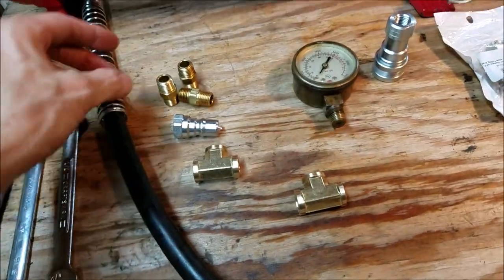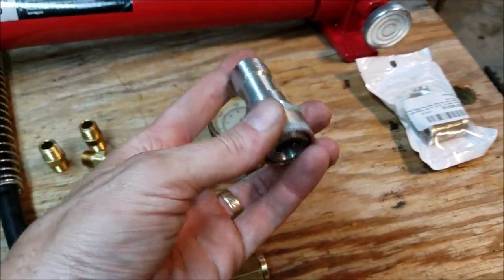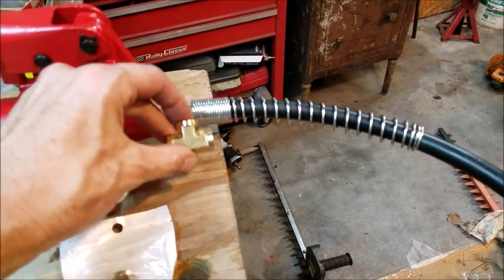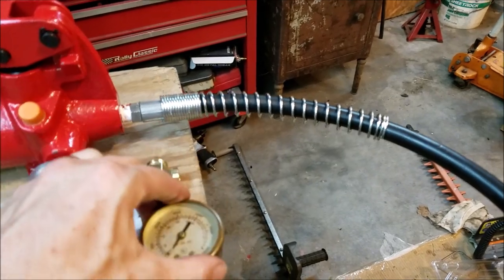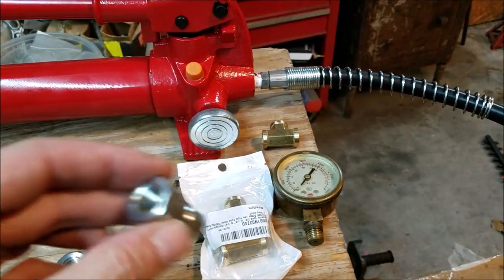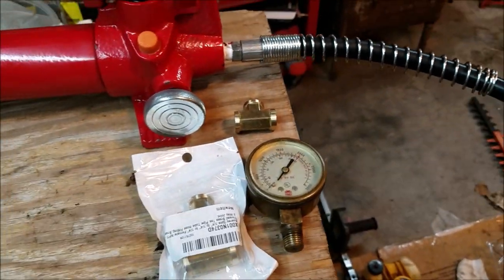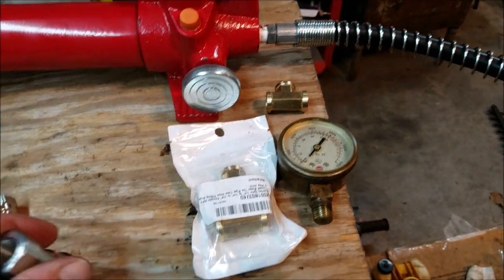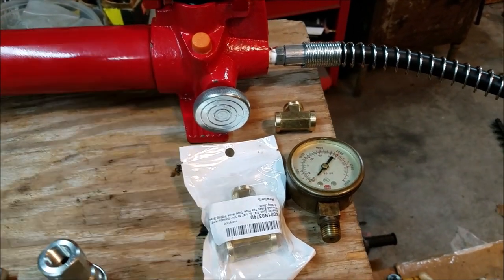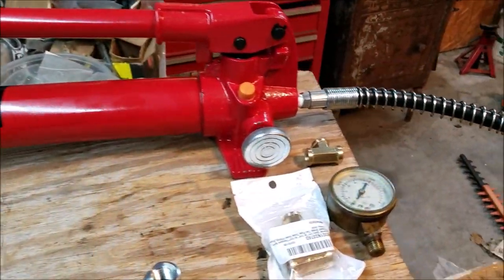It's just a quarter-inch pipe thread. I got some nipples, a couple of T's, and the handiest thing: a quick disconnect. I'm going to put a T on here, put my nipples in, have my gauge on it, and then have this quick connect attached to the RV. All I have to do is plug in my quick connect, give it a few pumps, watch my gauge, and when I get 1,500 psi I'll know the brake is released. It's got a check valve so the pressure won't bleed off. I think this will work for under $75.